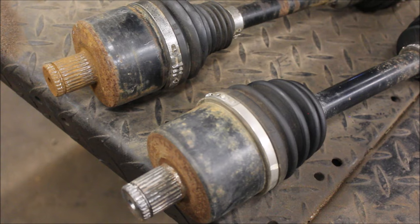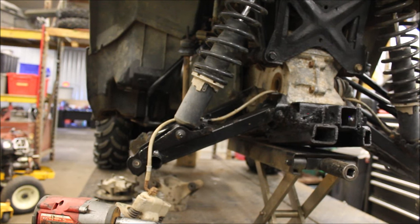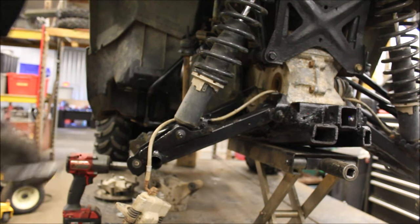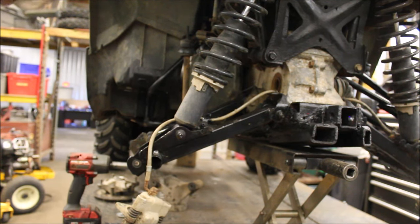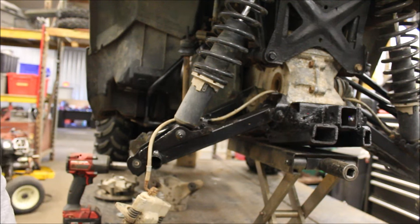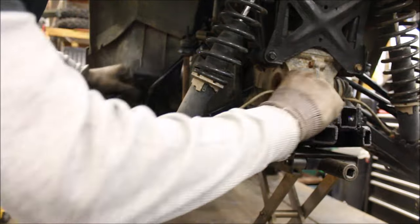And this unit should be good to go. While you're at it, put some anti-seize on the threads. You hear about those guys that no matter what they do, they can't get these rear axle shafts off. You hear horror stories, oh, they hook it to their truck and try to pull it off. I actually used an air hammer on mine to get them off if they're that stubborn. Air hammer and two screwdrivers and pop it off.